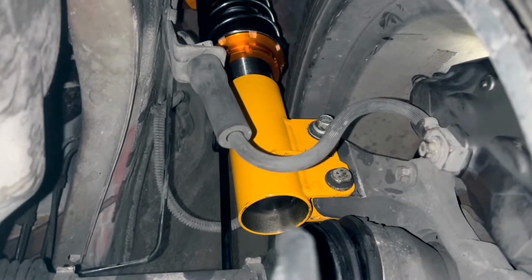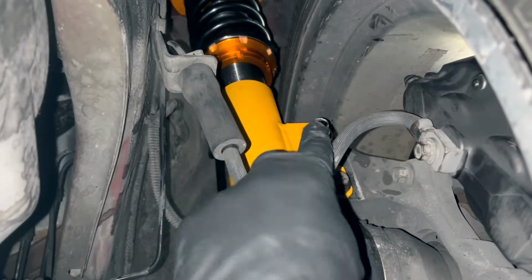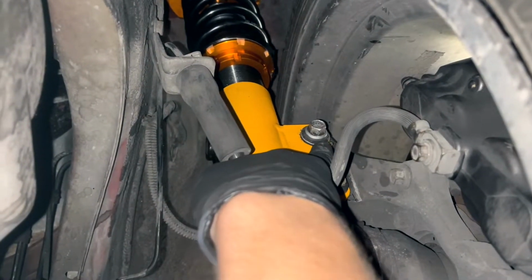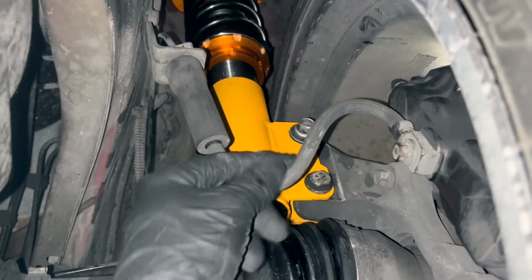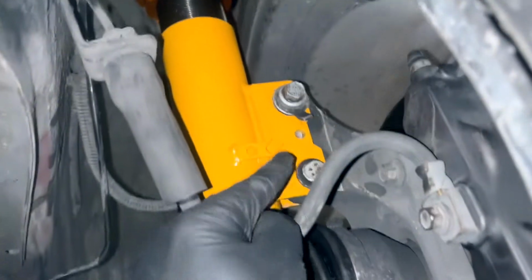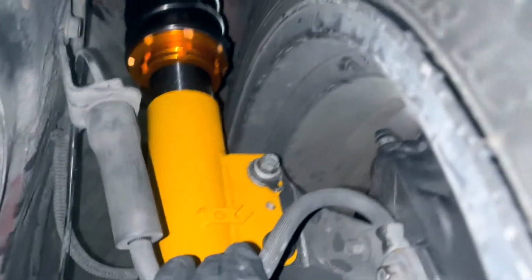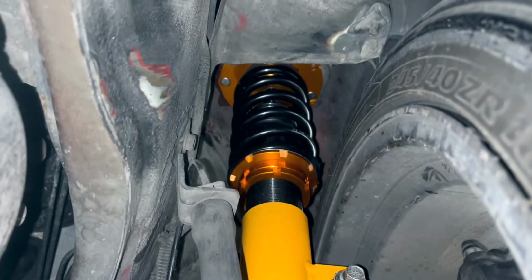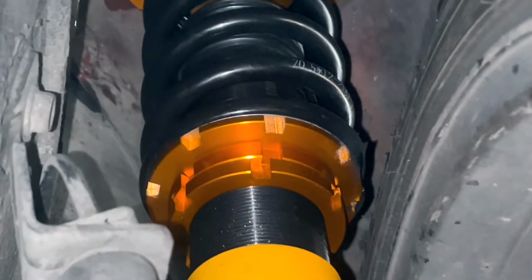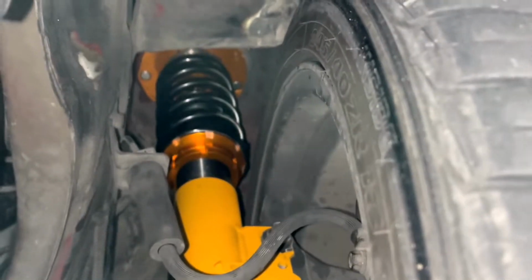All right, I adjusted our top camber bolt so that my little indicator is pointing straight down almost. Before it was pointing more towards the wheel. It's going to be really hard to see. This little guy right there. Boom. And it fixed our issue. Let's see here. Woo! Look at that. It's weird. It doesn't even touch the tire.